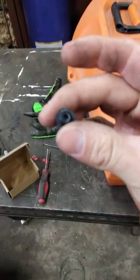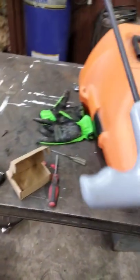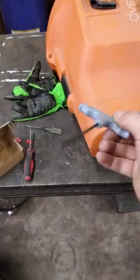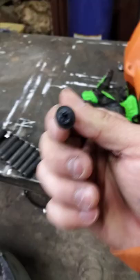The last thing you're going to want to take out is your fuel neck. The fuel neck has these little star bit screws. I just used a one-eighth allen head — those will also work in the star heads and vice versa. After that's done you're ready to lift.